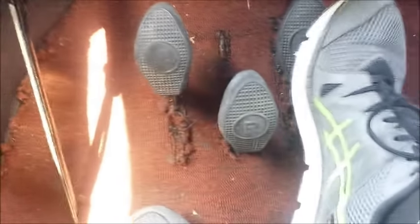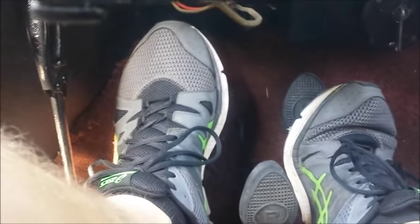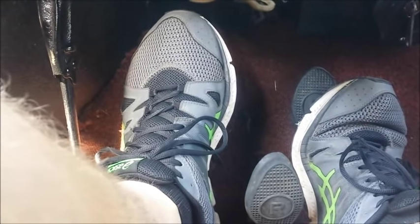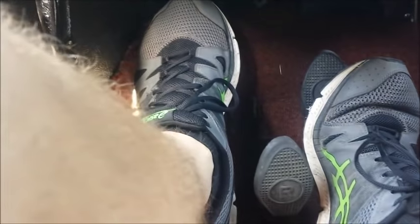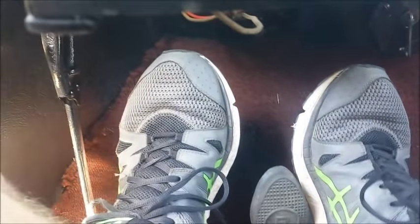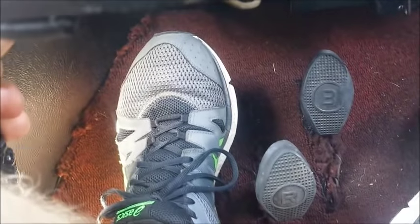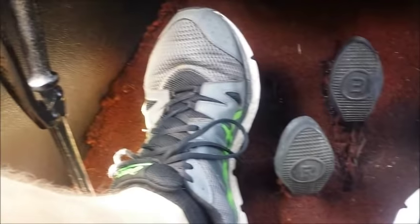When you want to stop, you've got to hold the clutch in the middle and press on the brake with your right foot. If you get in trouble and you're going too fast, you can press all the way down into low gear and the brake, and it'll kill the engine but slow the car down fastest. If you're in real trouble, hold the clutch in the middle and jam on reverse and brake at the same time, or grab the handbrake and pull that as hard as you can. That's high gear, low gear, and brake.